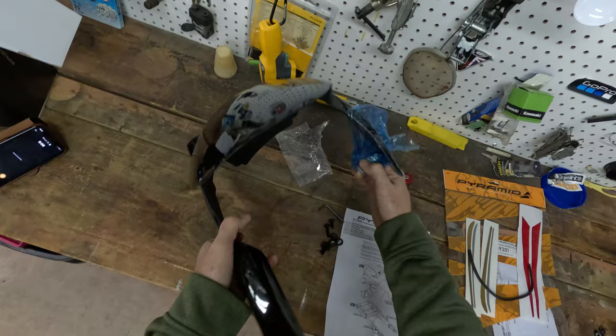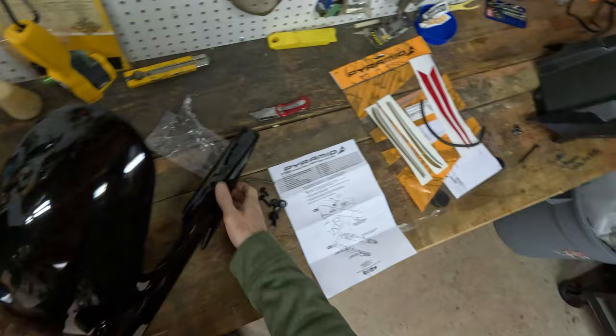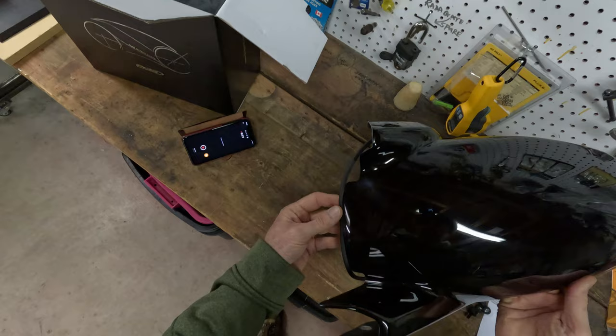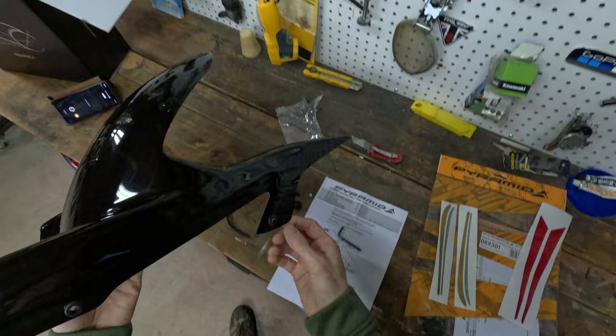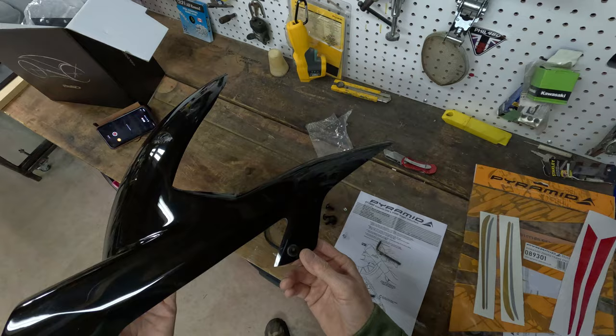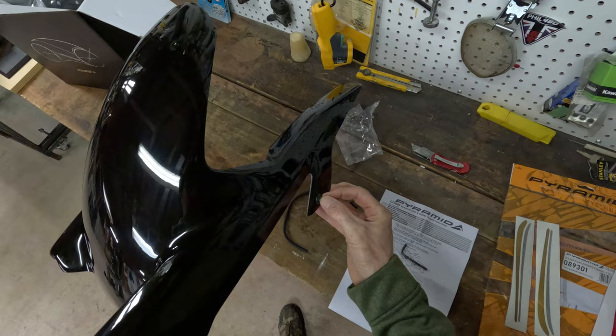Here is the hugger — I'm just taking the last of the blue protective wrap off. It's very nicely wrapped and fairly tough gloss finish, but I want to be careful. There's a piece of rubber that goes inside the edge here to stop it rubbing on the swing arm when you mount it — a nice touch. Getting the grommets in is a lot easier with a little bit of Vaseline — that really helps them go in. Then grab a collar and slip it in.